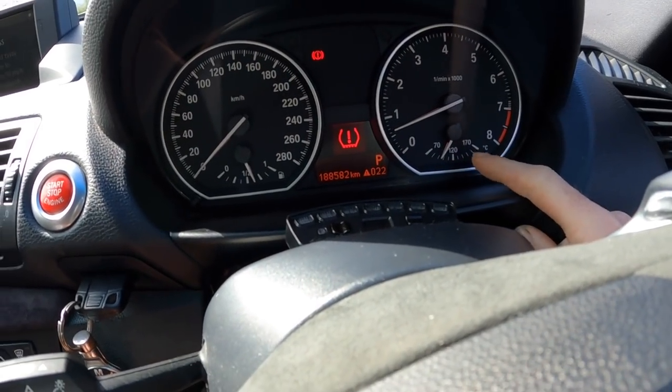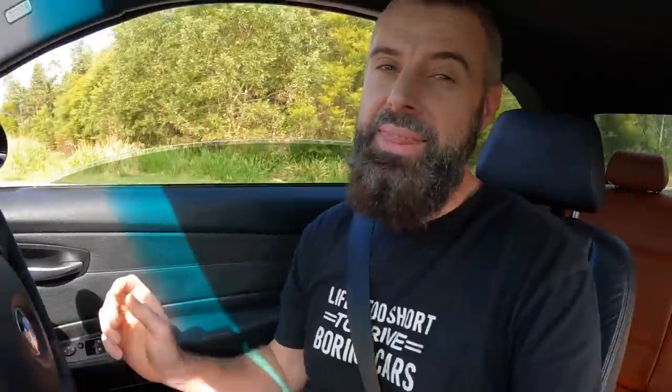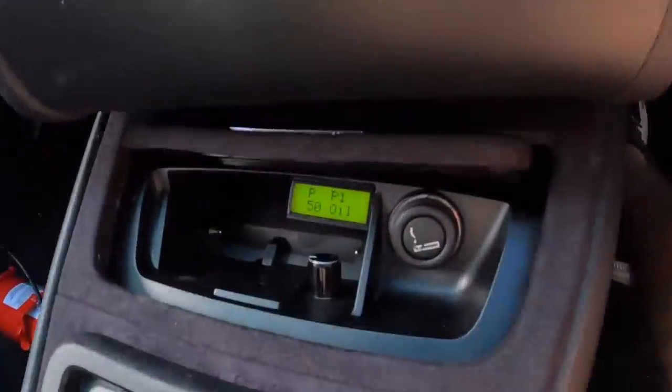The oil temp is now at about 95 degrees C — still really not hot enough to be thrashing an M54 — and the trans is at 50. You can be on a transmission when the oil's at 50; it'll be fine. Probably. We'll just wait for this car to go, and then we'll see if we can do some adaptations and see how the gearbox reacts to learning — see if it gets better or worse.